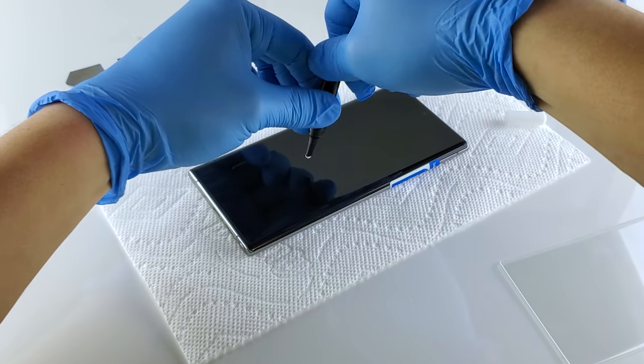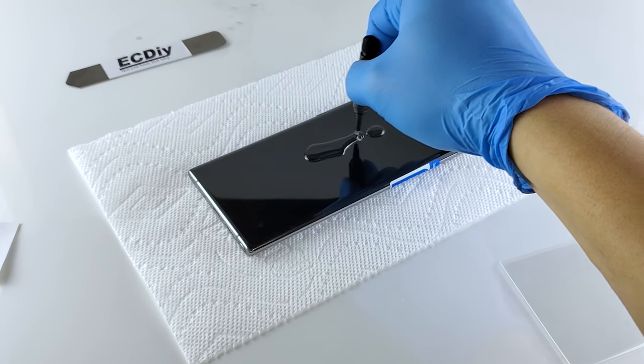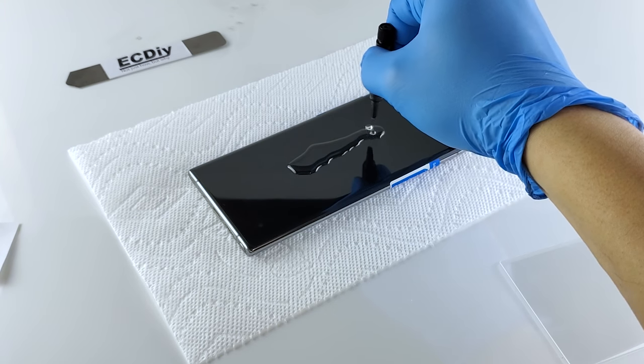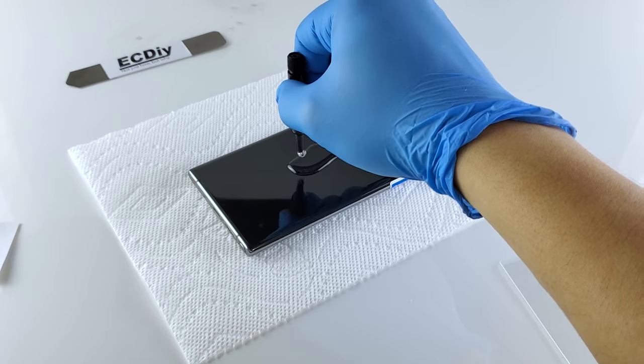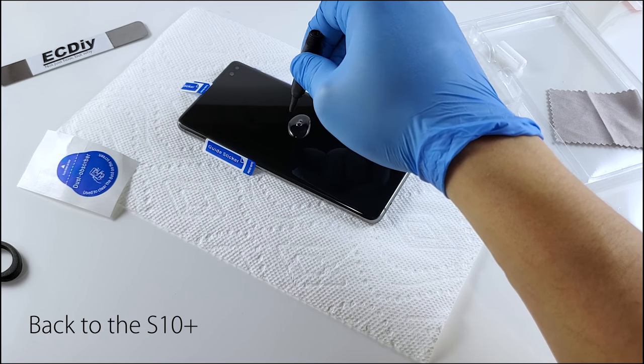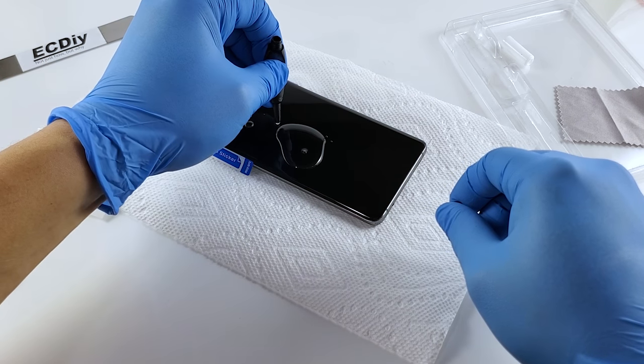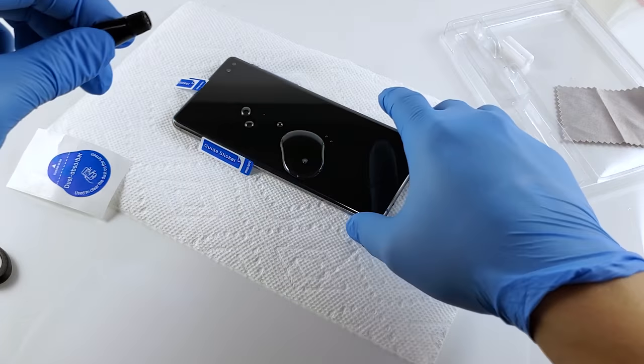Place the glue in the middle of the phone with the cut side down and uncap the other end to let air in, allowing the glue to flow out. Dispensing it in an oblong shape helps to spread the glue more easily. Squeezing the tube without letting air in can introduce bubbles, but it can be fixed. If your phone isn't level, you can shim it up with the foam the protector came in and spread the glue back to the oblong shape.